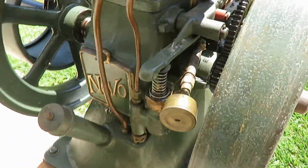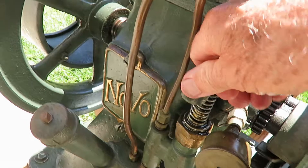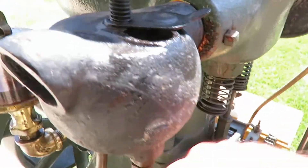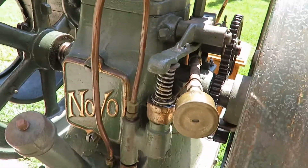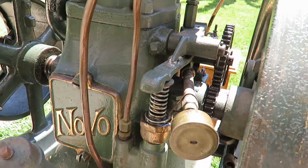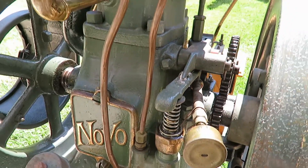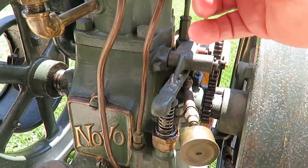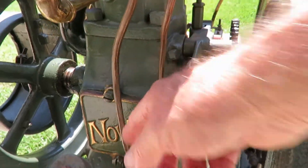This is the fuel pump, and you prime it like that — push it down a couple times until you get gas up. You can see it squirting up, and you know you've got gas. If it doesn't pump, you need to tighten your packing nut a little bit so it's not pumping air. If you tighten it too much, when it pumps down it doesn't come back up, so it's got to be just about right. It pumps gas up to here, reaches the level it needs to be, and then it just goes back down to the gas tank.